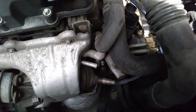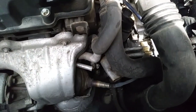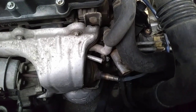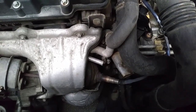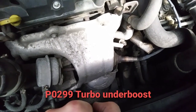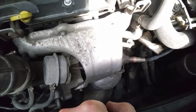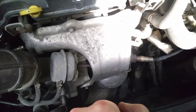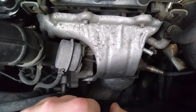The oil adapter o-rings do fail, and when they do they leak down towards the front of the engine. The oil outlet pipes to the turbo — the o-ring fails and then you just replace them. They're not too bad price-wise; I think I bought mine for about 30 bucks. The underboost code for the turbo — I had the code once, cleared it about a year ago, and it never came back. I was told the turbos do fail; I think it cracks and leaks out all the boost, but I'm not sure.